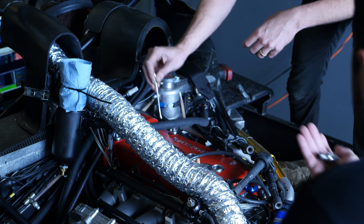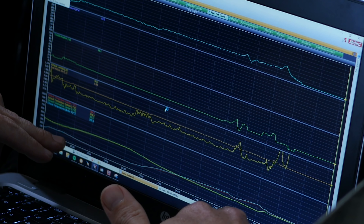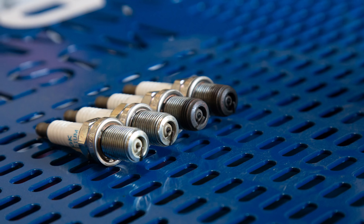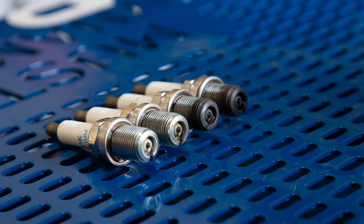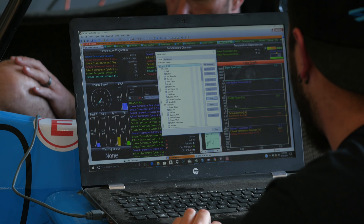At the moment, the evidence we've got is that there is a problem with two of the cylinders and the way they're running. This is evidenced by the exhaust gas temperature being logged by the MoTeC M1 ECU. And much more simply, it's also obvious when we remove the spark plugs.